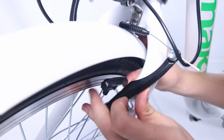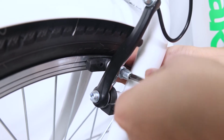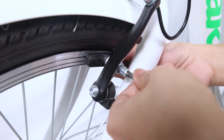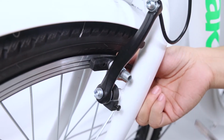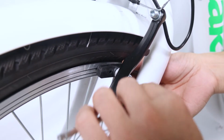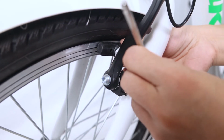Bring the pad gently to the rim and push with some mild force and secure the nut. The pad will tend to be self-aligning, and the convex-concave washers will put it where it needs to be, correctly aligned with two flat surfaces, the rim and the pad. Hold the pad as you do the final tightening. Repeat the process on the other side.